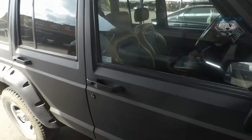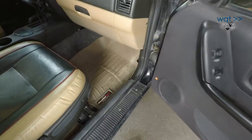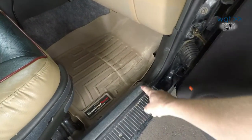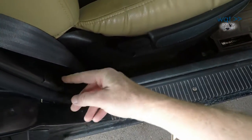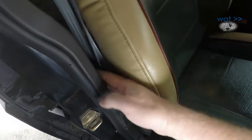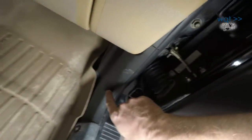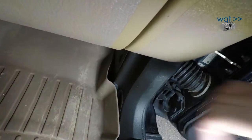Let's take a quick look at what you're up against here for trim panel removal. This particular vehicle has trim panels all the way around. The first one that has to come out is this one here — it has multiple screws and is also clamped around both sides of the seat belt area. This one here needs to come out at the same time as the seat belt, clamped around the front and rear door seals. The one covering the fuse panel has a bolt that has to be removed back there and then it pops out.